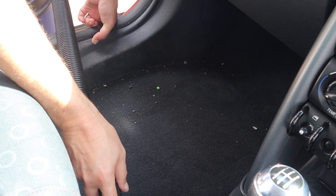Once I'm happy that the interior is all nice and clean, I can tend to the parts I've taken out of the car, such as the floor mats. These weren't actually in too bad condition, so just a quick vac. Then I like to hit them with the drill brush just to knock off any of that loose contamination that might be in them, back over it with a vacuum cleaner, and then give them the same drill brush and all-purpose cleaner wet vac treatment that the rest of the interior got.